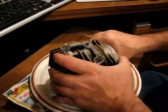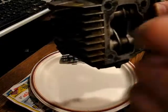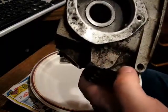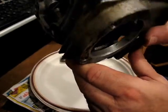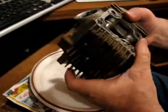All of that oil ends up in the rocker box and goes to the floor of it, then drops down — because it's oriented like this — so it drops into a cavity in the bottom. You can actually see on the outside that this block right here is hollow, and it's blocked off on the end, but there's an opening inside the cam gear cavity. So it all ends up there, then runs back down through the cam chain cavity and goes back into the crankcase.